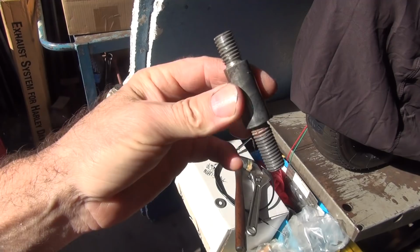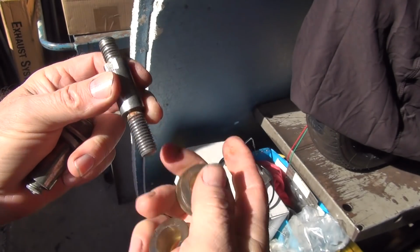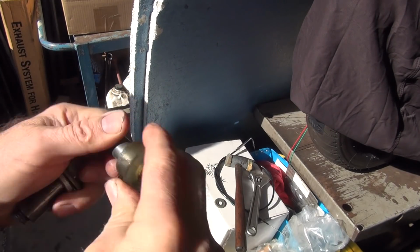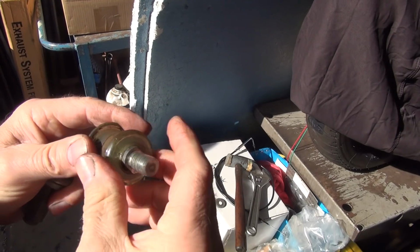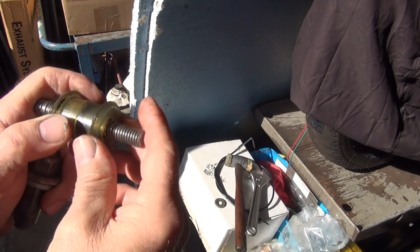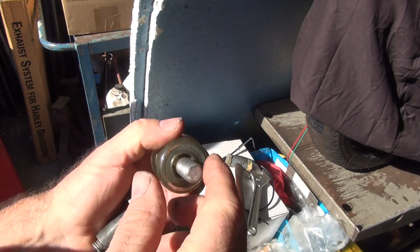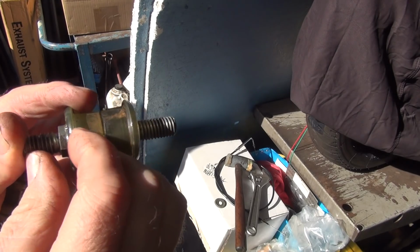Okay. There we go. So that's a Harley stud, looks like to me. So he sheared off one of the bolts off of that. Now the torque of this is governed by the height from here to here. So see how there's no compression on that? So why was this thing not all the way in? See, for some reason this rubber wasn't all the way compressed in there like it should have been. That's why they had the stupid washer on there, trying to get extra squeeze out of it.